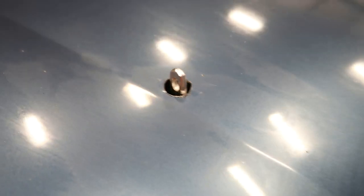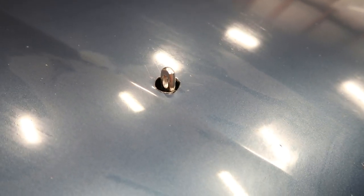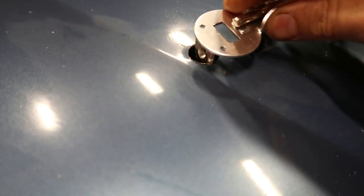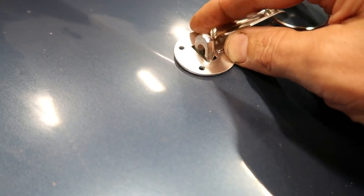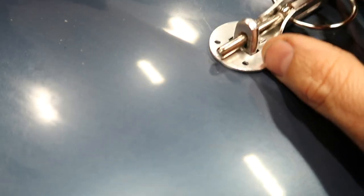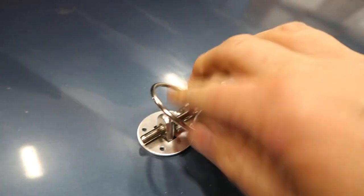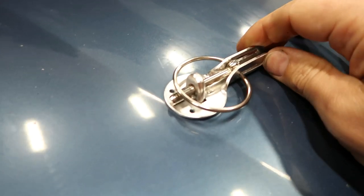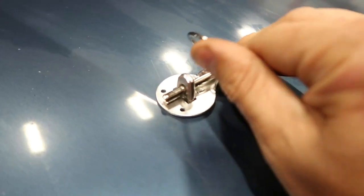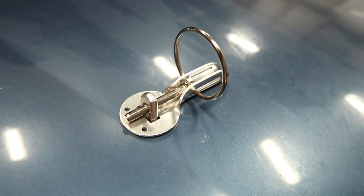Look at that — that's good clearance. Holes are nice, and obviously that works quite well. The next step is to place the actual pins on, just roughly place that on there, put the pin through the center, and obviously that's the end position once it's looped over. All I need to do now is drill these little holes, and then that rivets down and we're done.